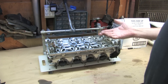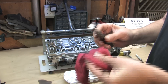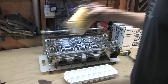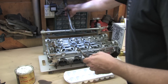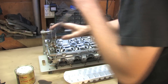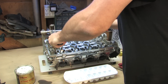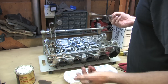When you want to begin taking valves out, all you have to do is get your magnet. Sometimes it's handy to have a pick and a tub of grease, but you use this magnet, center the tool over the valve spring, and press down. It just breaks loose. Grab your keepers with the magnet and there you go.